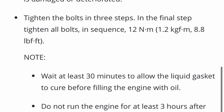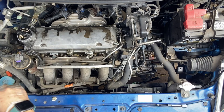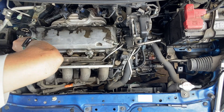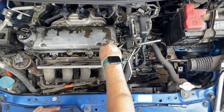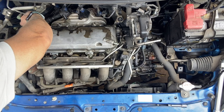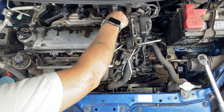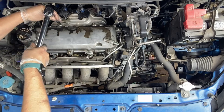Then this goes over the tightening pattern. I made sure to go through that pattern and just slowly tighten them down as I was going through. As a note, it did say to do it within five minutes of putting the gasket material in, and I actually did do that. I had replaced the seals for the bolts before I did any of this, but I just put it into the correct order for the manual. And I'm just tightening it down based on that pattern in the manual.